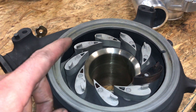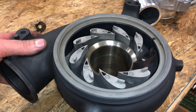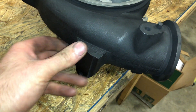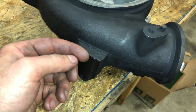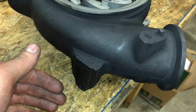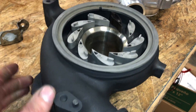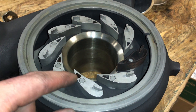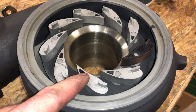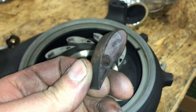You really need to make sure you have the correct vanes with the correct turbine housing. The best way to tell if you have a late model or early model — you'll see this bracket right here. All the later models had this extrusion right here, and the earlier models just didn't have that; some were cut off and some weren't even part of the casting. The difference in measurement is that the later model (04 to 07) was 13.2 millimeters wide, and the 2003 vanes are 15 millimeters.